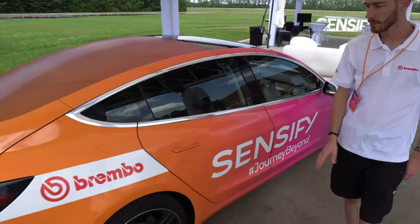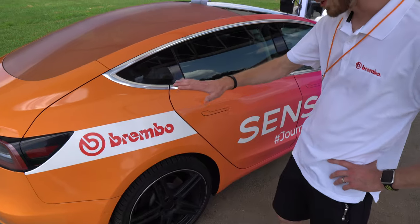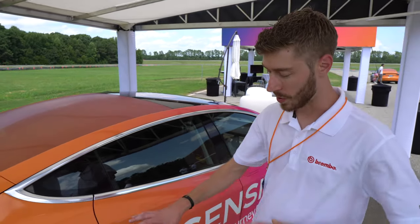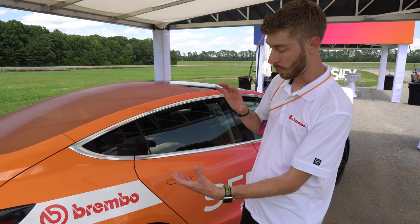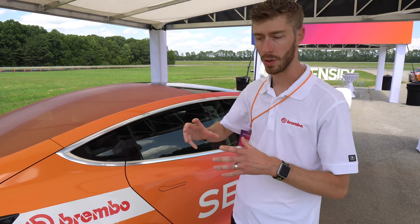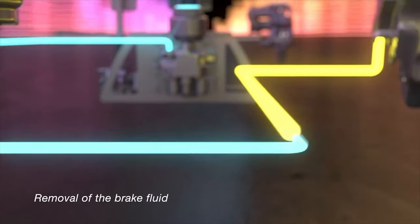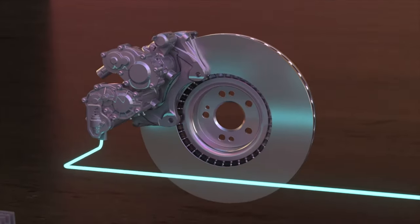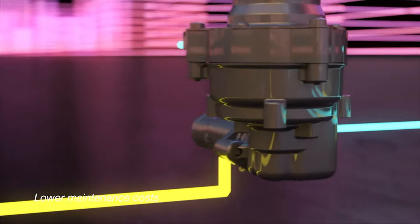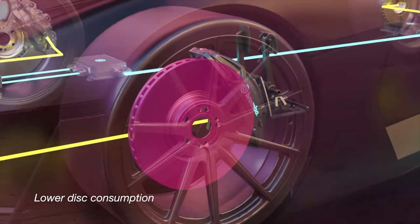Back in the rear — in the presentation, Stefan, the CEO of North America, was talking about how there's no brake fluid going back here. This is taking it even a step further. Not only is the driver decoupled, but you have no hydraulic fluid in the back. They're electromechanical — it's just a motor that pushes in a piston and that puts the brake pressure on the wheel. So there's no bleeding process, we can integrate the parking brake directly into that system, very compact, very easy to package, but you still get individual actuator control on every single wheel.